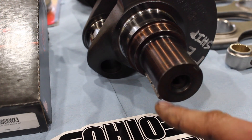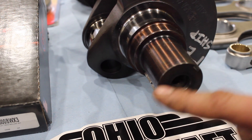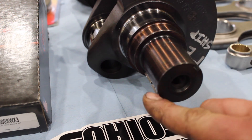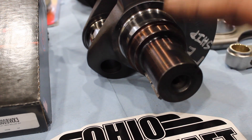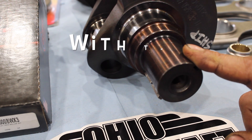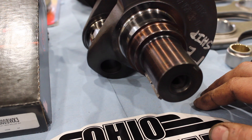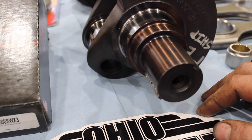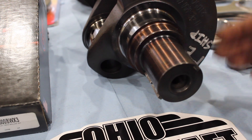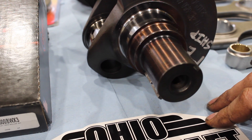This crank is also dual-keywayed. If you're not sure what that means on blower applications, you'll oftentimes cut an extra keyway 180 degrees apart from the normal keyway — it just helps when you're driving the blower so it doesn't spin and break the keyways. The old normal-snout crank we ran before was also drilled with both keyways using an ATI balancer, and we still managed to crack two of them. So I'm still not getting a full answer on why. I even talked to the blower shop and quite a few supercharger guys — it's kind of hit or miss, and they can't give me a straight answer either. I thought maybe something was wrong with the blower, but nothing is checking out, so we're upgrading to the big block snout and we're going to run it on the dyno and see what happens.